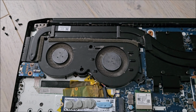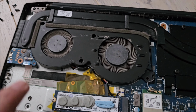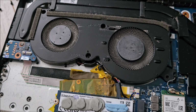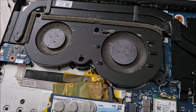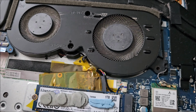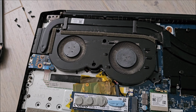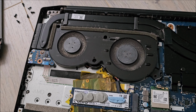I will link a video in the description where I show how to do that. Many say do not allow these things to rotate because they will generate electricity. Normally they cannot do that because they have diodes to prevent reverse voltage into the motherboard. But yeah, if you can, stop them from spinning, do not break the blades, and don't do this inside the house because you will be putting lots of dust everywhere, and if your wife sees you, you have an issue. So let me do that now.